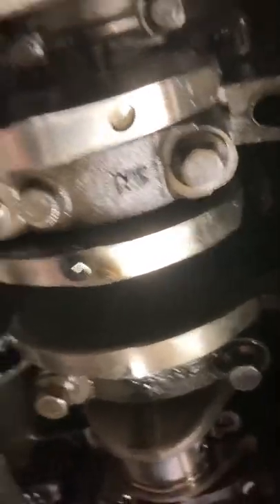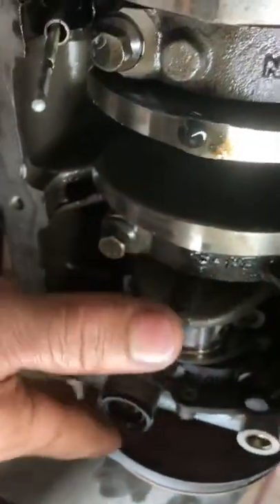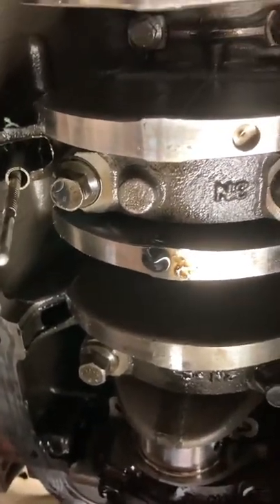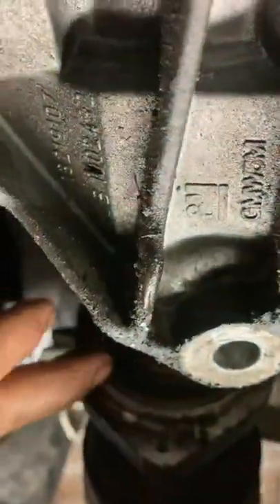It's not actually as horrific as you'd think. It's a bit of a challenge to get the sump out from under here — you need to get a finicky angle to get it out. The trick is to take the carrier bearing carrier out. You don't even need to take the circlip out of it — you literally just undo the three bolts.